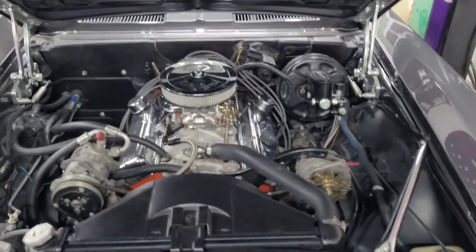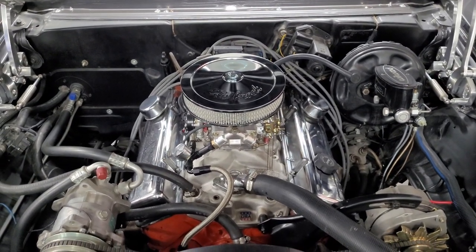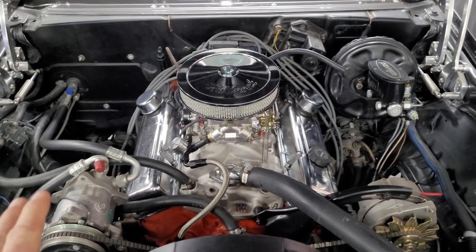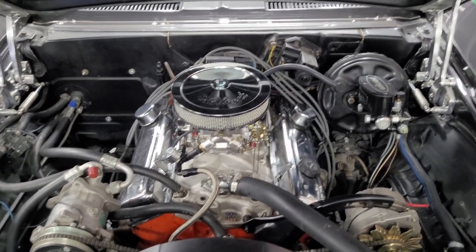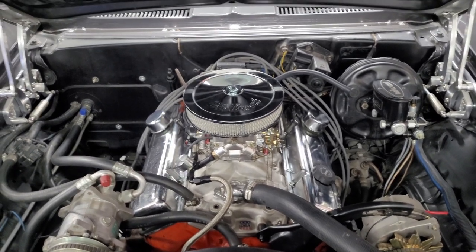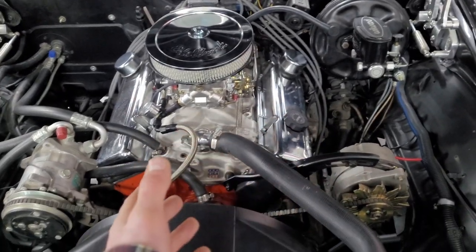Boom. What you see in front of you is a 307 small block. At least that's what I'm told. Which for you Camaro gurus out there, you Chevy small block gurus, out of the box is about 200 horsepower. So that's not gonna cut it. So I'll get back there and we can confirm the casting number, but it's either a 307 or a 327